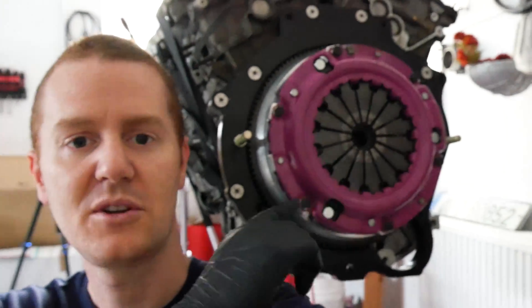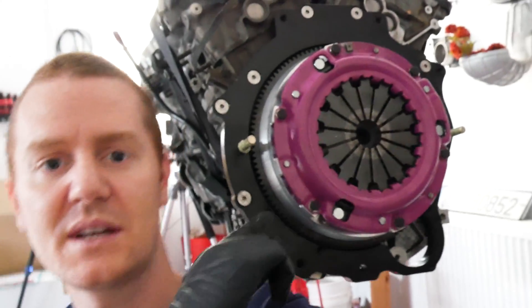So we're trying to get off the main crank pulley here, but when you try and loosen it, the whole engine is turning over. So what we need to do is take off the clutch again so that we can put something into the flywheel here, so that we can brace it with a breaker bar or something like that, and then we can get the tension on the other side. So looks like we're taking off the clutch again.